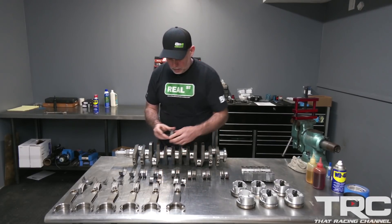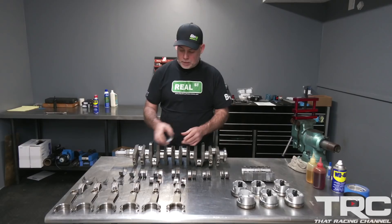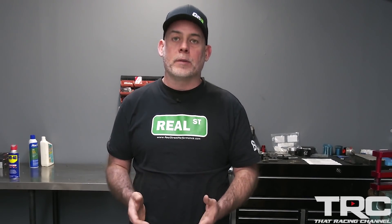When you look at that discolored or highly polished patch on the connecting rod bearing, the oil is being displaced and wiped. That's basically how the bearing fails — from excessive cylinder pressure and poor oil quality. By poor oil quality, I mean this is a factory oil pump. When you run a factory oil pump with less than six quarts of oil and run it over and over again, the oil gets aerated. While you can still maintain pressure on the gauge, what's being pumped through the engine is not good quality, and that creates that damage.